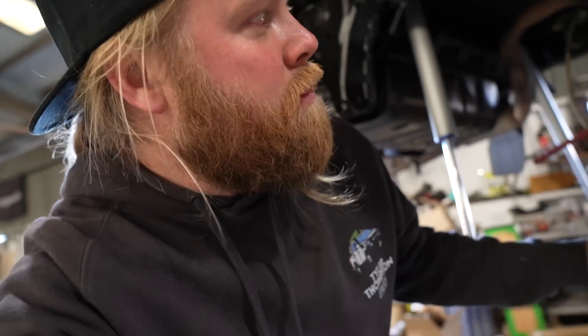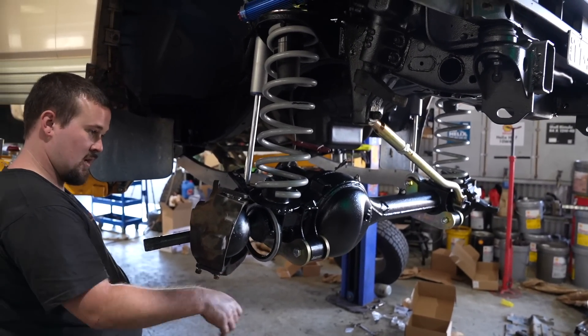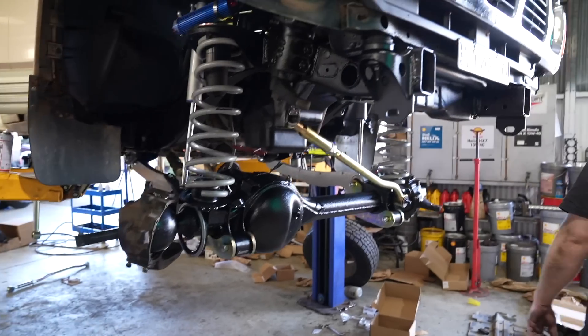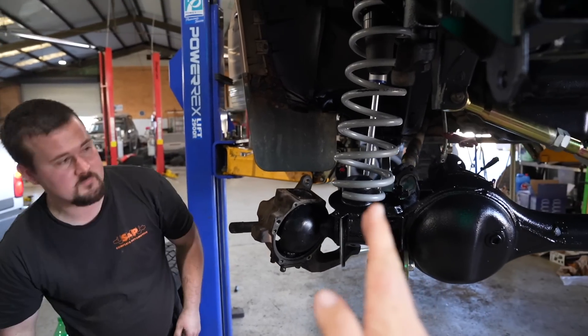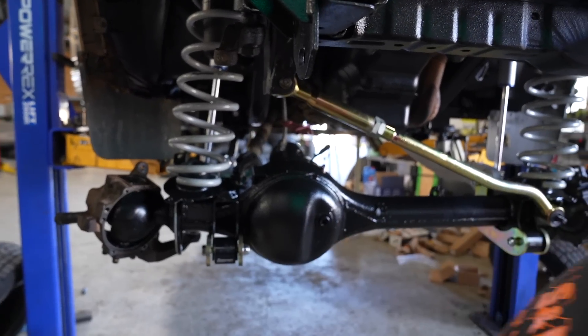You're not going to be able to break these. And then adjustable uppers as well. This side is kinked to allow for a tank to go in there if I want to do that one day. The shocks are mounted from the top as well, so we've got all this dangling — that way when we bring the diff up we can just bolt it all in to hold the diff. And then Panhard's in. So can we get a Panhard explanation? We get an adjustable one so we can centralise the diffs under the vehicle. Once you put a lift in it goes off to one side if it's a fixed length, so an adjustable one lets you correct that after.